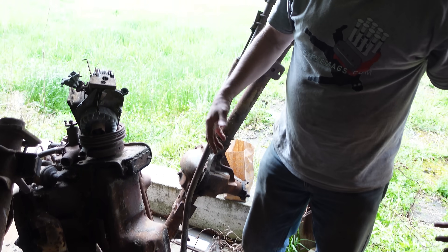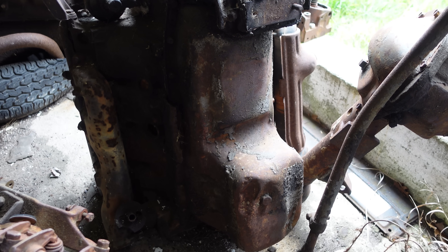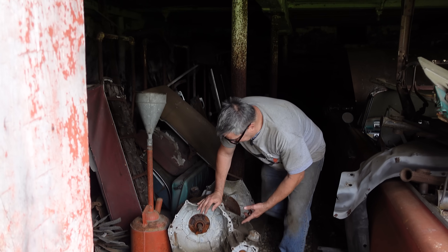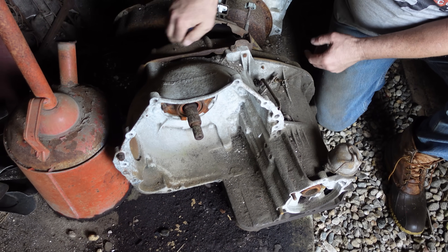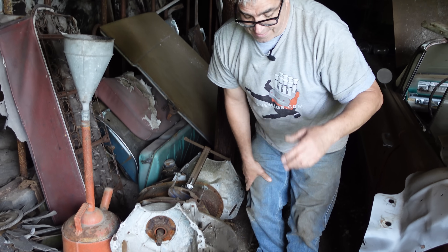You've got to love the Toronado — the front-wheel-drive model from 1966 onward. This is an Oldsmobile 425 out of a Toronado. How do you know? The oil pan has this indent where the drive shaft would go on the front-wheel-drive setup. Let's take a quick walk to see the turbo 425 front-wheel-drive Hydra-Matic that would have been coupled to that 425. What this basically is is a turbo 400 with a little extra torque capacity. The engine goes here, and there's a chain underneath that sends power through the front half shafts. The differential goes right here, under the oil pan — thus the recess in the Toronado-specific oil pan. The beauty of that oil pan is it takes an extra quart of oil, so guys with 442s and other muscle cars love those Toronado oil pans.